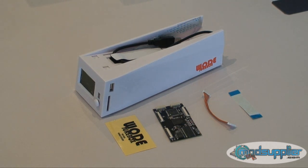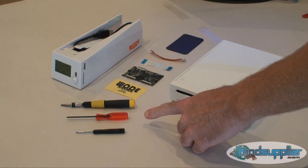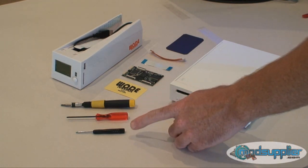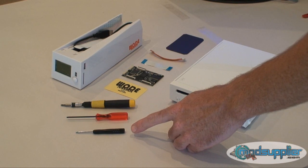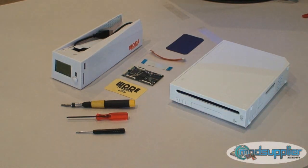That's the brief introduction to the Wode Jukebox itself. We'll now move on to showing you how to dismantle the Wii and installing the Wode. Now we're going to take the Wii console apart to install the Wode. The tools that you'll need for this are the tri-wing screwdriver, a normal Phillips screwdriver, and instead of tweezers to get the stickers and the legs off the Wii, we're just using a small flathead — though you can use tweezers as well if you like.